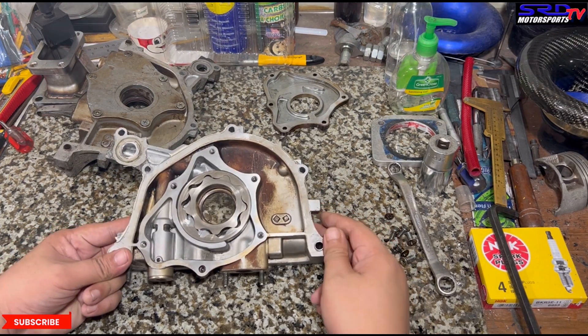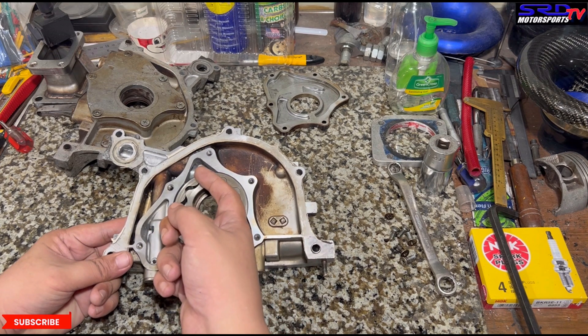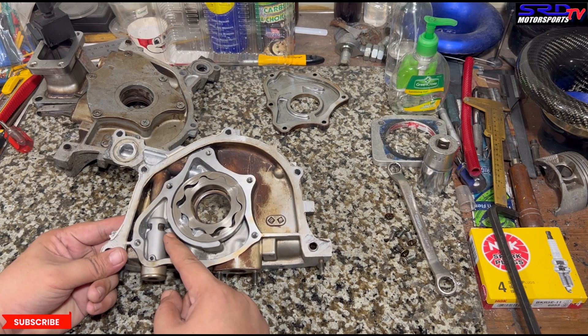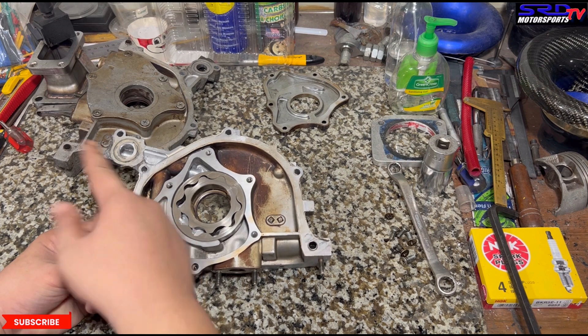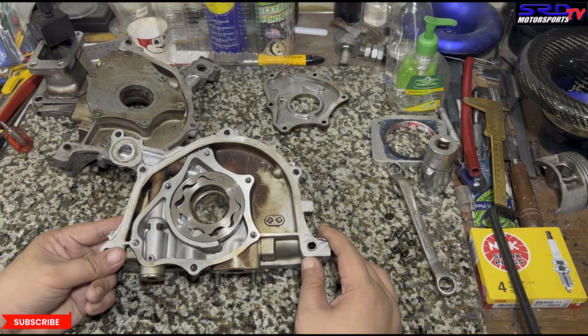As the crank turns, the gears turn, oil is sucked in, feeds to the gears, then goes into the block. Here is where the pressure relief spring is — it opens around 85 or 90 PSI. Honda could have dumped the relieved oil back to the oil pan, but instead chose this area so that as oil is relieved it comes back to the oil pump gears, which prevents cavitation — that's how smart Honda was. So when you think about shimming it to increase the limit, even at redline you're actually causing the oil pump to cavitate. That's quite dangerous, so this is something we don't usually shim.